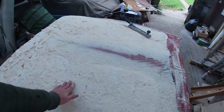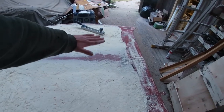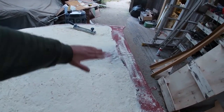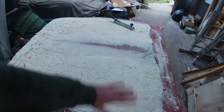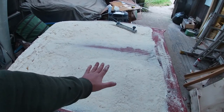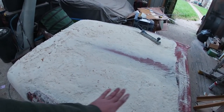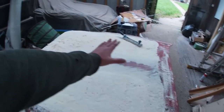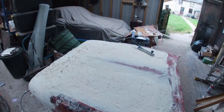And whilst the foam gives you a very rough finish, when we get our first layer of glass mat on that, that'll be nice and flat. It doesn't matter if there's going to be air pockets underneath the glass, because we're going to build up from that. It doesn't matter what's underneath the glass, it matters what's on top of it, because that's the side we take the mold from. So anything underneath it is irrelevant. We're just using the foam to get the rough shape first of all, and then we get a layer of glass on, and then I can see it in its entirety.